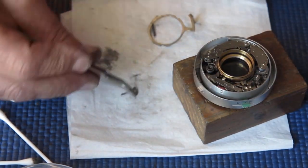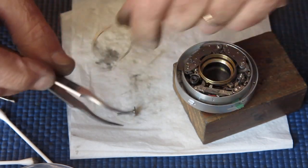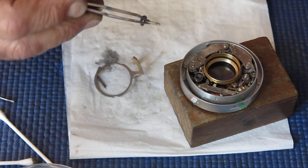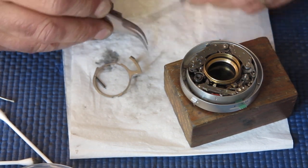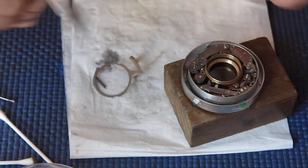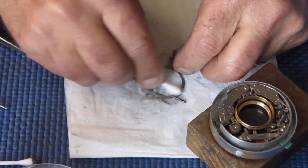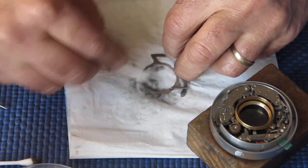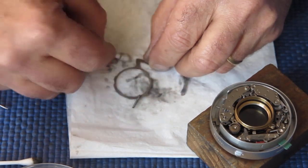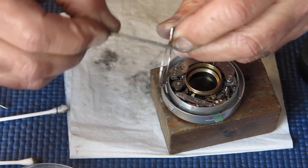This is the main gear here that cocks the shutter. That shaft runs through from the back, is cocked here, twister here, which rotates this, pulls around the cocking ring, also setting the main drive spring at the same time. And the main drive ring here, well, it isn't really the main drive ring at all, or the settings ring. It does set some things. It doesn't actually cock the shutter in these shutters, but it does moderate the release action.